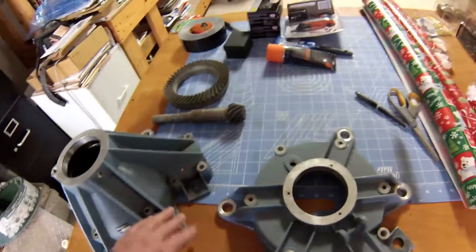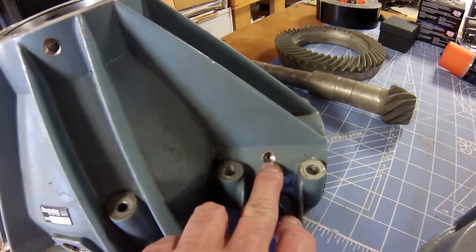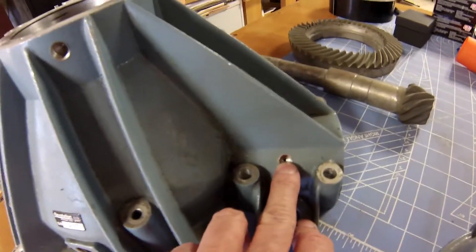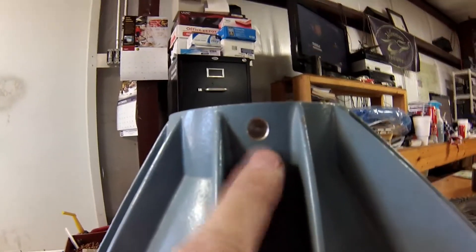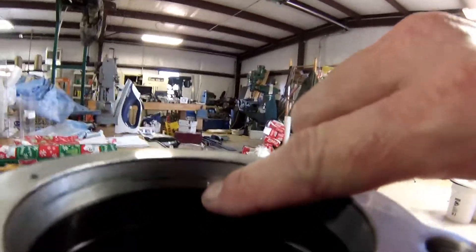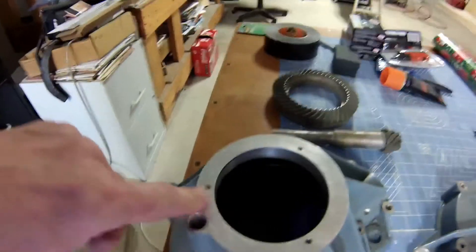Got the mass support upgrade done up here. Now, on the upper, you can see that it's ported. It's a certain size hole to allow a certain amount of oil through there with our pump. This is the inlet hole — you can see it's a smaller hole up in there. And then over here on the opposite side is a return. The holes are drilled just above the bearing but below the seal flange. I actually notched the seals a little bit so that they can drain out. And then it's drilled for the seal retainer here.